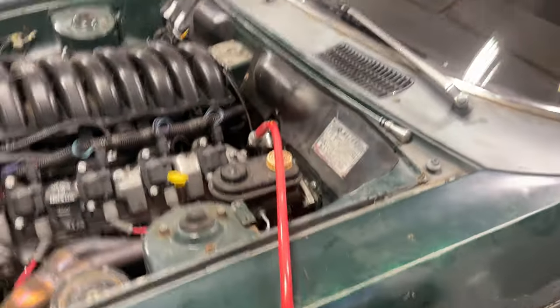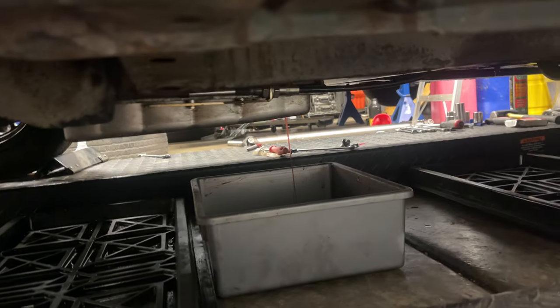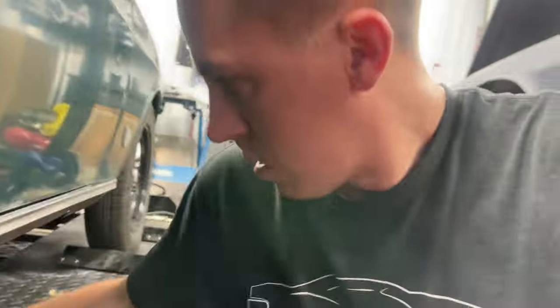It's all back together. On the 6L80 you actually start them while they're running and keep adding fluid until it comes out the little leveling drain bolt. I got the car running, pulled the level bolt, and there's no fluid dripping out of the level hole so I just kept adding fluid. I didn't have my funnel so I used this little handy dandy deal, just pumping fluid in until it starts dripping out. It took a couple quarts — it definitely had been running low. A tiny bit of extra transmission fluid never hurt anyone, especially in a car that usually kicks it out.